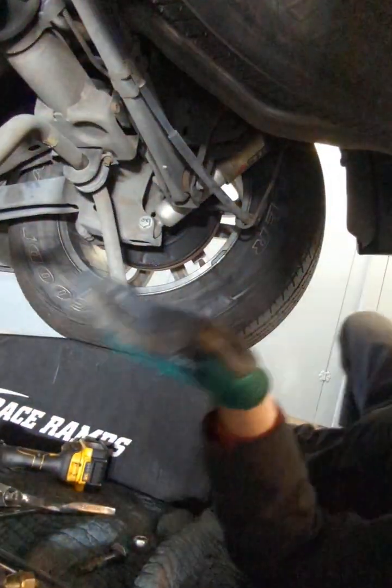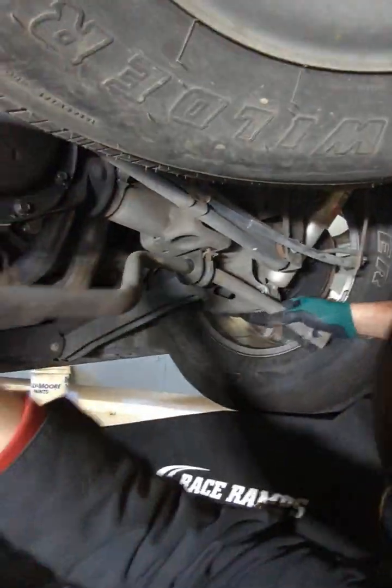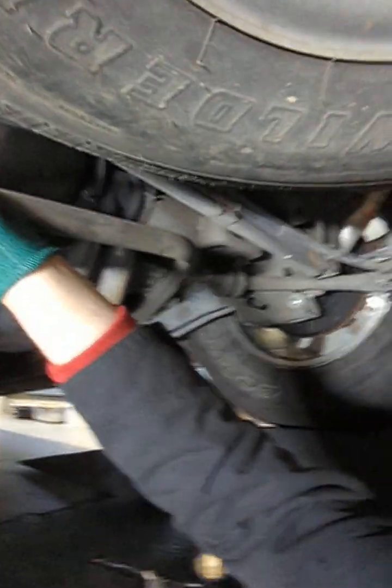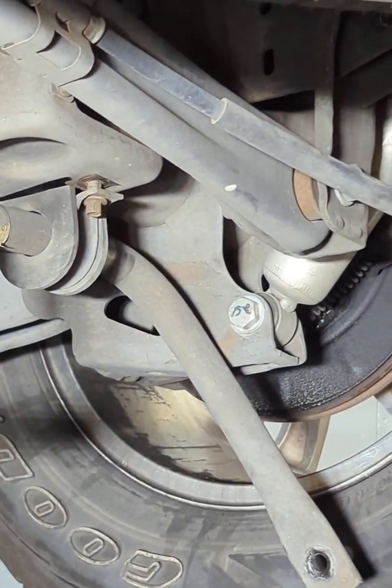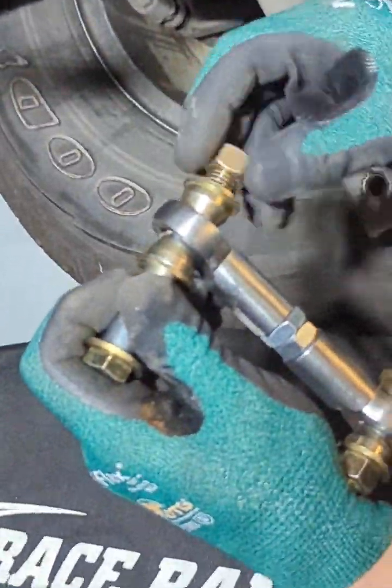All right. So now comes the time you have to move the sway bar over, right? Because if you don't move the sway bar over, that's going to happen. Not good. So easy. Get to the sway bar, see? Pull it over. Foot over, line it up. So we'll have to move it above here. So let me get the end link set up first. And this is where the passenger side comes into effect. You have a spacer here. The spacer is going to go on the inside of that mounting bracket here. I'll show you guys.